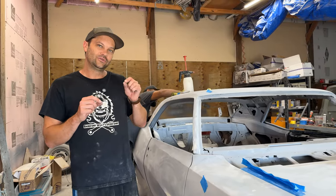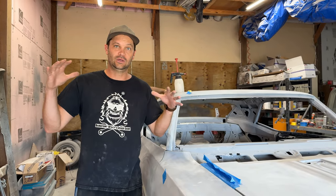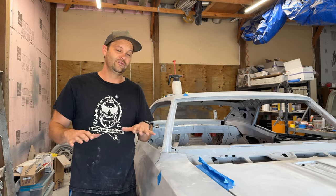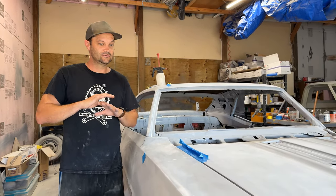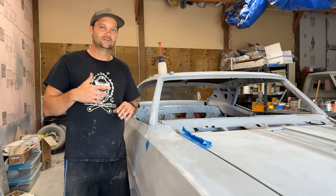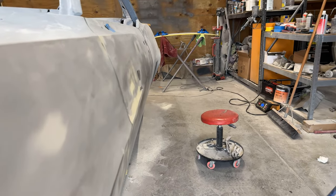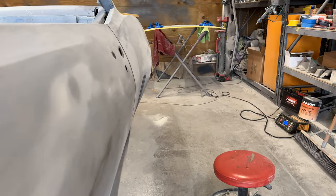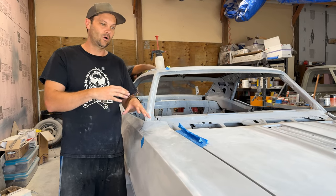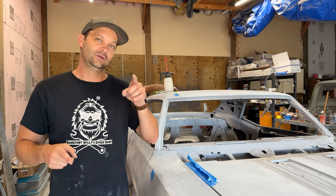All right, so you've seen a few little things here — mostly gray. All the big splotches of glaze are gone because we've got everything big cut down and we are flat, very flat. A few faint colors you see are just a few high and low spots that we just feathered out. What we'll do next is color. We're going to do a mechanical bond with a layer of primer. It'll flash and we'll add the color over that, making a really nice mechanical bond to cover up all the scratches. The next time you see this, we are going to be in color.